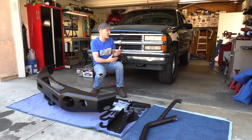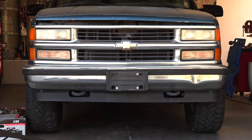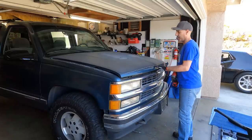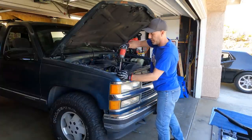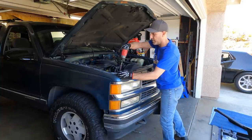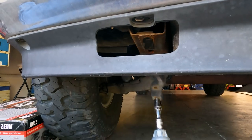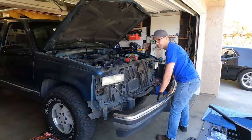But for now, let me bring you in. We'll go ahead and pull all of this old stuff off. And then as we start to put this in, I'll tell you about it. This is one of those exciting upgrades because it's gonna change the entire look of the front of this vehicle. So to get the grill off, it's pretty simple — pull these bolts across the front here and there's a couple of snaps down low. That was pretty easy.